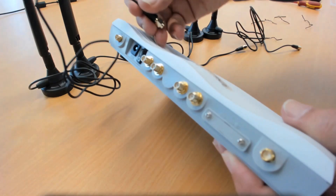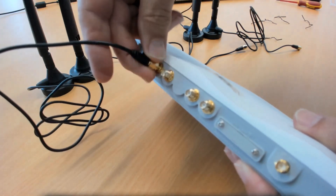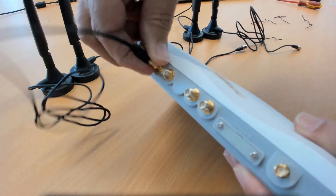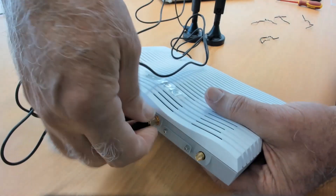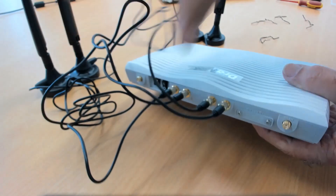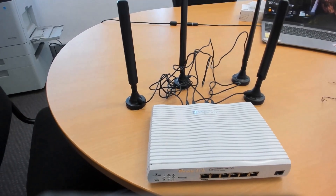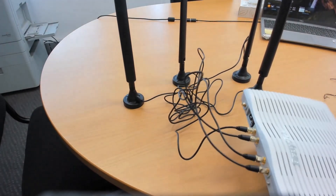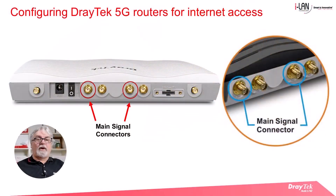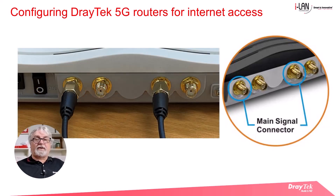For the best signal you'll usually want to get the antennas up as high as possible, and remember they are magnetic so they'll stick to a comms cabinet, rack, or anything else metal. There is a rack mount bracket available for these as well if you want to install the routers into a rack. If you have limited space and want to tidy up the cables, you can wind up the excess and use the twist ties to make it neater once you have the antennas in the best position. For an outdoor antenna installation you must have at least two antennas connected — the left socket on each pair nearest to the power switch. Once connected it should look like this.